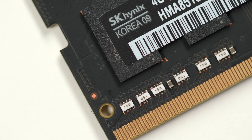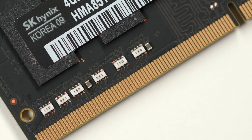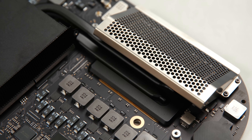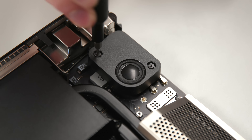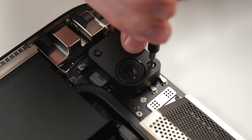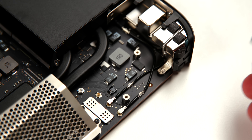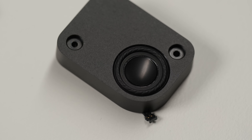This base configuration has two sticks of 4GB DDR4. So yeah, you can replace your own RAM. I'm not going to give Apple full kudos — I am glad they kept using SODIMMs rather than soldered memory, so it is repairable and upgradeable. But at the same time, it feels like they purposely made it difficult to do. It's not hard if you're familiar with computers — you can probably do it in half an hour — but it's clearly designed to discourage users from trying. Unlike Mac Minis of years past. The speaker comes out very easily with a little surface-mounted connector. I don't know why there is a speaker — it sounds awful — but there is one in the Mac Mini.